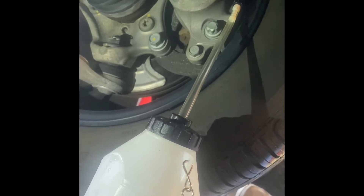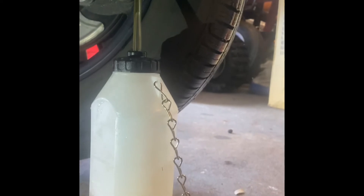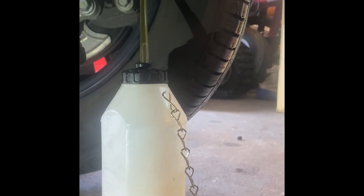After the first wheel, I'm doing the rest of them with the wheels left on the car. This is what it looks like — I'm hooked up, open the bleeder a quarter turn. Fluid's coming out, no air, right into the bottle. This is the second bottle — I emptied it one time, so I definitely got everything out of there. It's slow, but it works. Just don't run out of fluid in the pressure bleeder. Keep the pressure up — I pumped it up to 30 pounds.